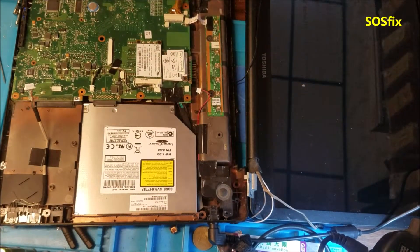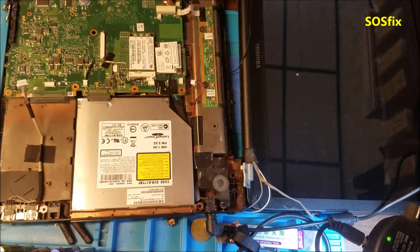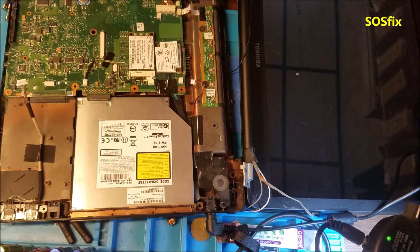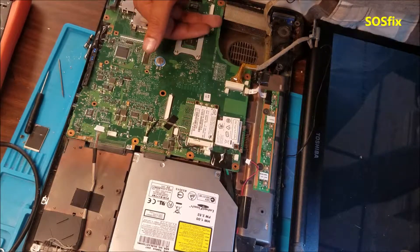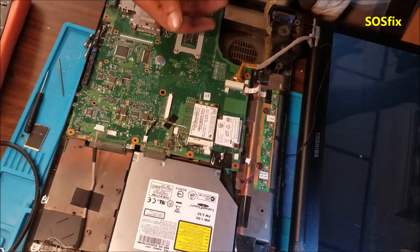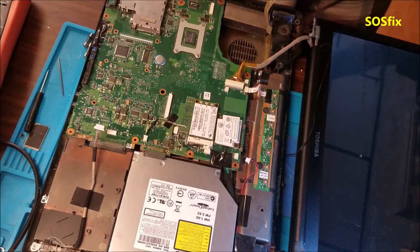When you're fixing computers, you'll see a lot of motherboards missing some voltage — like 5V or 3.3V. At that time you need to check around the power supplies: maybe a bad capacitor, or the switches, or sometimes MOSFETs are bad. A good working CPU should get warm little by little. If it gets warm too quickly, something is wrong with the processor. If it doesn't get warm at all, you need to check that processor. I hope this video is gonna help someone facing the same issue. Until the next video, have a good one.